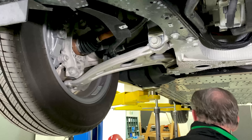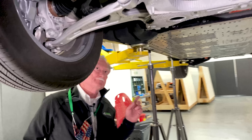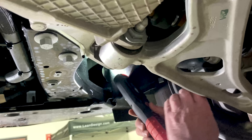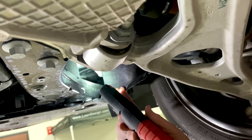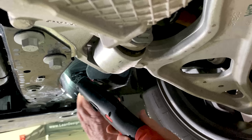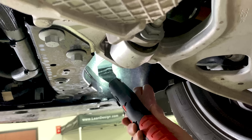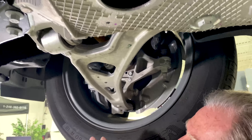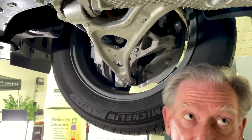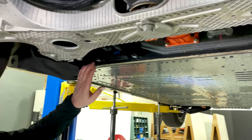This is a little harder to see — let me get the flashlight. If you look at this cradle part, you'll see it goes way over inside. The reason for that is SORB — Small Offset Crash — which you have to pass. We call it a SORB tusk, and what it does is push the car away from whatever is coming at your wheel, allowing the car to absorb the shock instead of shoving the wheel into the passenger compartment or smashing into the battery.